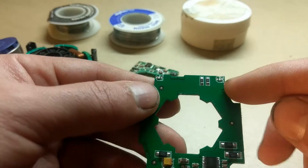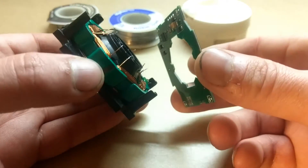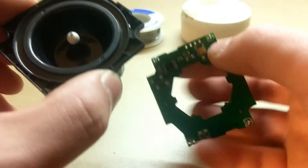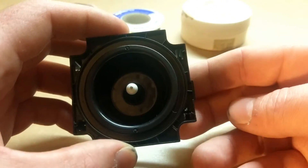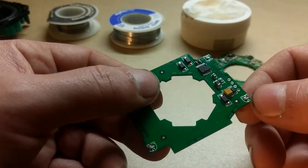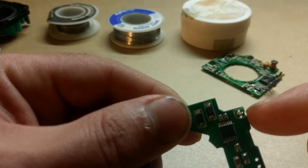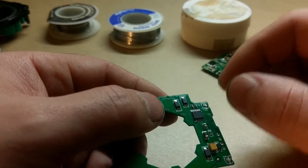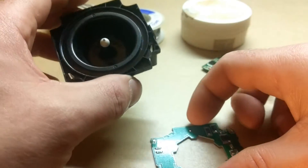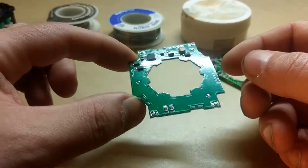On the four corners, be advised when you buy this — there are very small LEDs already soldered onto the board. When you go to put this back on, you'll see that on the sides there are holes that go all the way through, and that's where these LEDs will line up so the light will shine through. If you're really good at micro-soldering, you can de-solder these. There are also two holes right next to the LED where you can solder in another LED with leads to come all the way up through. We're just going to stick with the blue — so if you have a clear top, just remember, these do have blue LEDs and your clear top is going to light up blue.